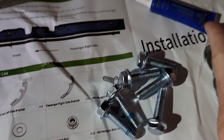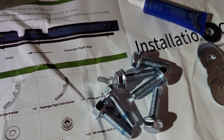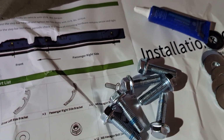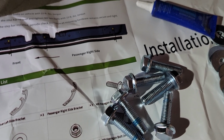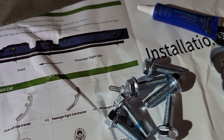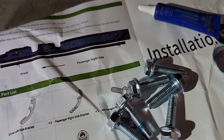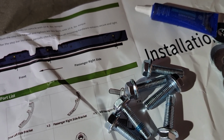And this stuff will last you forever. You don't need to use a ton of that Threadlock. As long as you torque the bolts in, you don't need to use that. Just remember, blue is kind of temporary, and red is permanent Threadlock. So don't use red on anything that you'd anticipate ever having to replace or remove, because that'll suck.